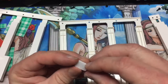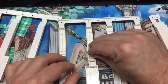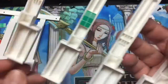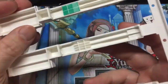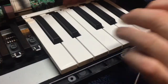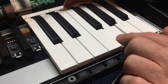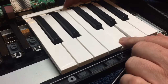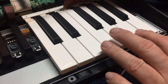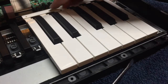Alright, I've got my pad all nice and cut. I'm just going to peel the backing off and attach it to the area that touches the rubber keypad itself — it should give just a little bit of extra push on the pads. I did actually see this in another video. I wasn't sure if the keys were going to line up properly, but as you can see it actually does. What it does is make it a little bit firmer on that one key, so just be aware that the travel is going to be a little different when you do this.